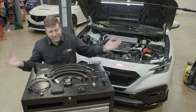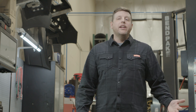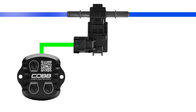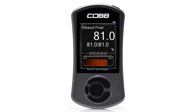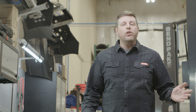That's exactly what this kit does. The fuel part of a FlexFuel kit is where we squeeze out all that extra juice. And to handle that, this kit comes with an ethanol content sensor. This installs along with some provided OEM-quality fuel lines and measures the percentage of ethanol passing through it, then sends the signal directly to our bespoke Cobb CAN gateway, which provides access to the car's controller area network. So the data from the ethanol sensor can communicate with the ECU, which is calibrated by the Cobb access port with a FlexFuel-specific tune that is provided with the purchase of this kit, while also displaying the current percentage of ethanol in the fuel in real-time so that you can watch on the access port screen.